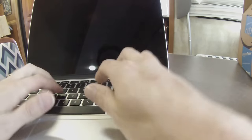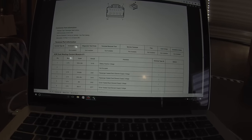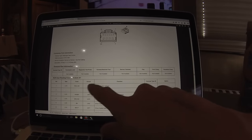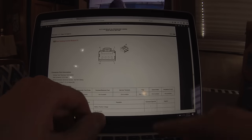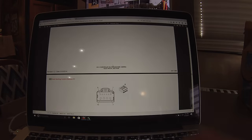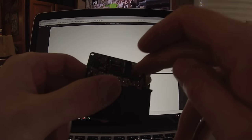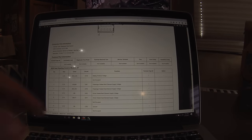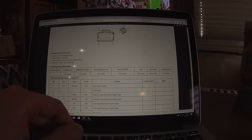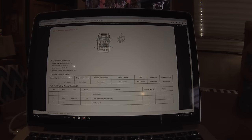Looking at the pin outs: on the big 10-pin connector, pin 1 is battery voltage and pin 10 is battery voltage again. There's one ground. My guess is pin 1 (the small pin) provides voltage for the control board, while the big pin actually controls the seat heaters on the FETs. Then we've got supply voltage for the passenger and driver back and cushion on pins 3, 4, 5, and 6 — four pins across the top.